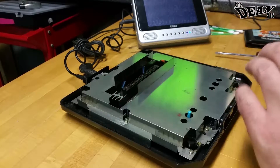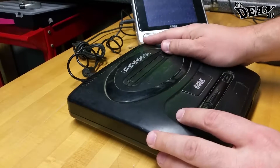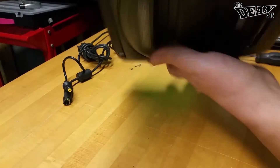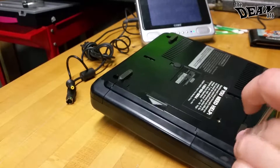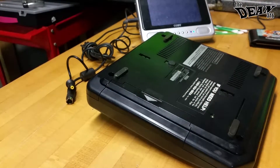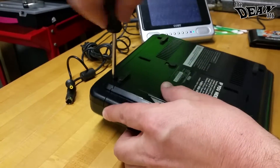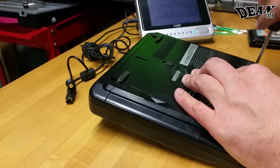Final step — the cover. These Model 2 Genesis consoles are pretty simple to assemble and disassemble. The case literally just slides back on top. Check all your seams, make sure there's no gaps. Flip her over and put the four outer case screws back in. When you're putting anything together that has screws all spaced out — in this case one in each corner — you want to crisscross the screws, like putting a wheel back on a car after changing a tire. Put one on and then put the one across from it on. Don't put them on in a row, because if it's not sitting quite right you could have it lopsided.